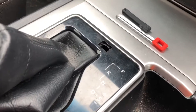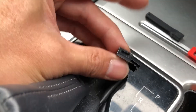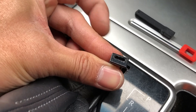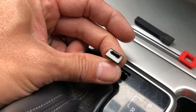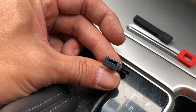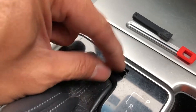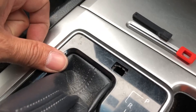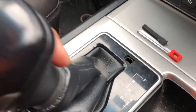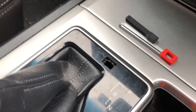This is the shifter area, and that hole there is normally covered up by this little plug here. This has been removed prior to me having a look at it — the customer definitely didn't do it. So obviously a mechanic or someone wanted access here to press the button down in there to unlock the shifter, so that you can shift it out of park if you want to maybe move it on a hoist or just position it without having to start the engine.